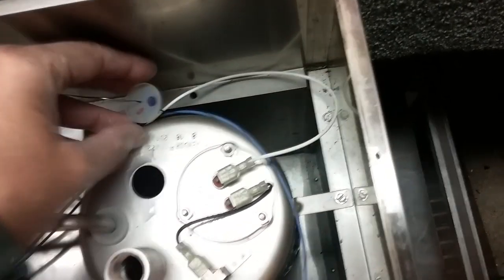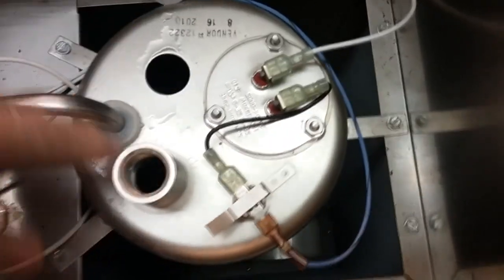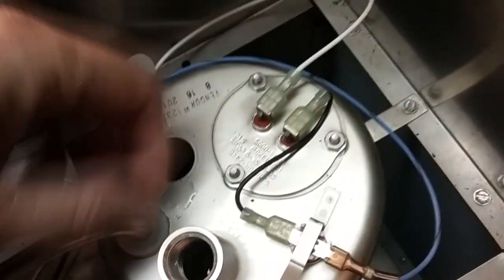I don't see any corrosion — looks like it has been well taken care of, could be cleaned a little. This is the overflow hose, and it has a good seal on it, nice and tight. I might just service this tank while it's in the unit, but I still have to get that out in order to take the lid off the tank. Actually, this may be a sealed unit — it's a little different than the ones I've worked on in the past. The older style had a cover that would come off with a big gasket all the way around. Apparently they eliminated that gasket by making it a sealed tank, because you can take the heating element out from here, so we will do that — we'll take the heating element out and clean it.